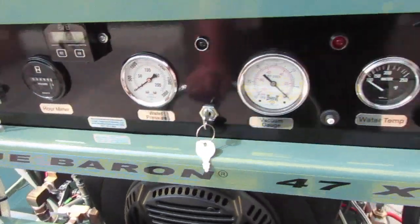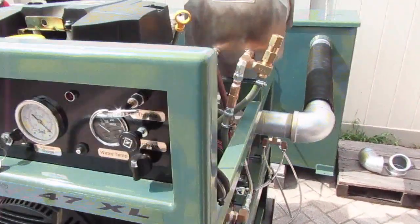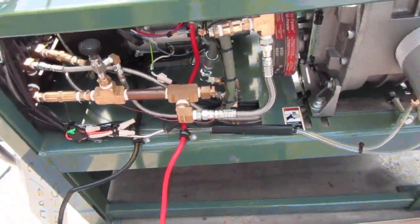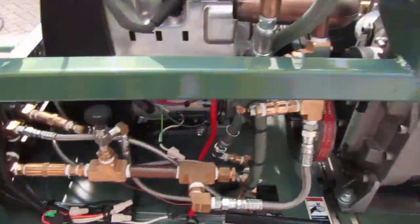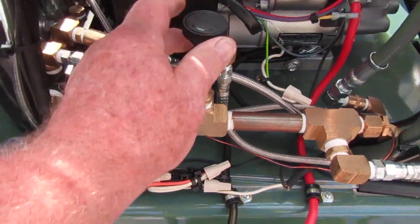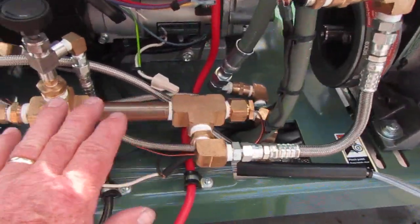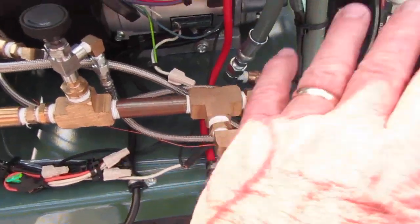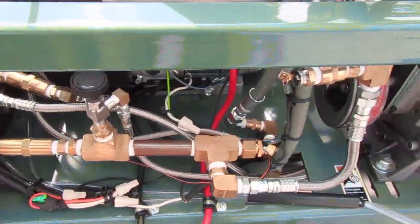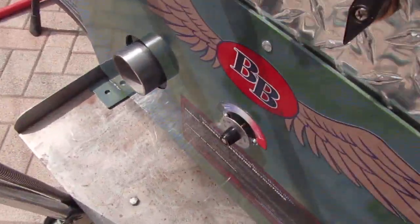Anyway, nice unit — well operating, well constructed. As you can see, real easy to work. We have a bypass here that we just crack open one quarter turn and leave it there. That allows the full signal of hot water to not be stagnated, but to move through the system in order to get full response time for temperatures that are set by your thermostat at the bottom.